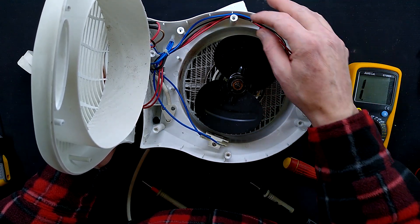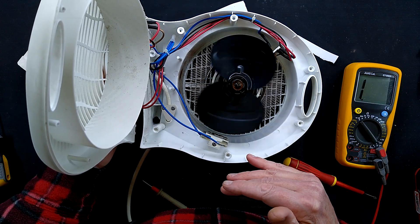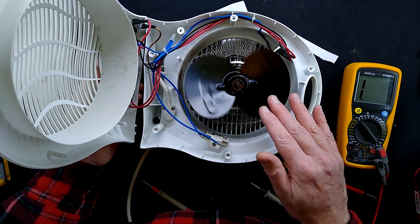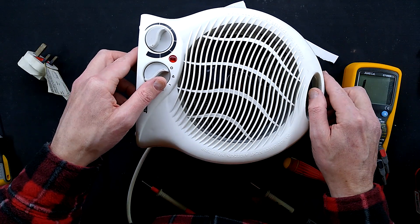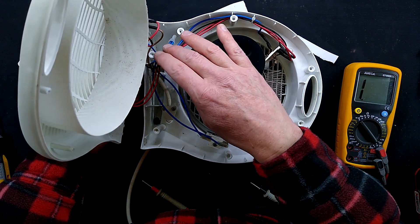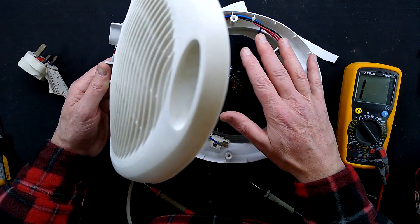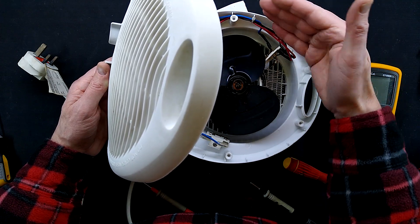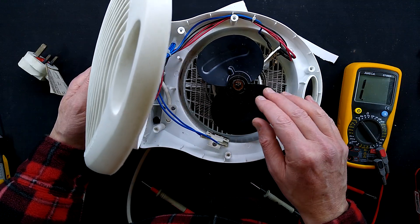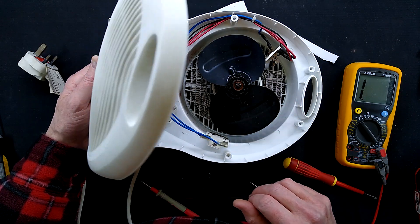So in this instance it is recoverable. Now all I have to do is screw this back together again. I might leave out the anti-tamper safety screws because they're just a pain in the ass. Ralph can have this back now with a warning to not store it out in damp garages, and also to make sure he doesn't cover them. That is actually a win - that is a good repair. It's kind of important when you put it back together to make sure all the wiring is dressed into the correct place. It's worth taking photos when you do stuff like this to make sure the wiring is routed around in the correct location, kept well away from blades and things like that.